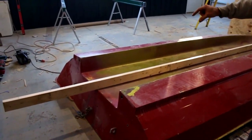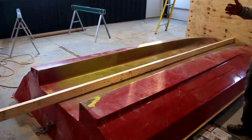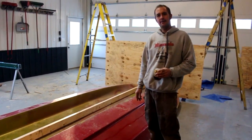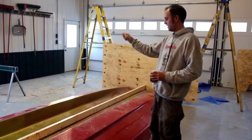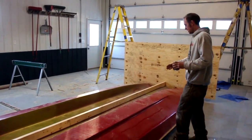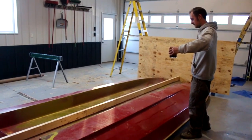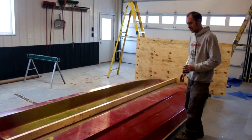Plywood so that that's running down the center as sort of a spine. Keep it from moving and keep it stronger. Then I'm going to have to grab a buddy who can hold each piece level, you know, scribe that through, notch it through, and add some bracing and attach each one with a piece of plywood in, or a piece of 2x4 in between each piece of plywood.